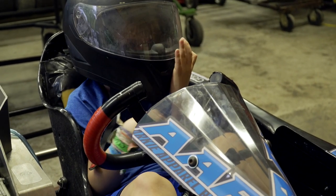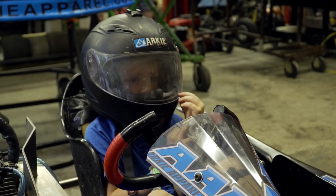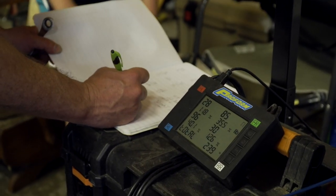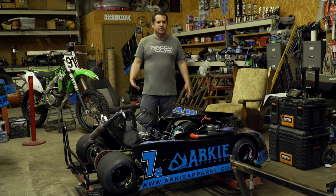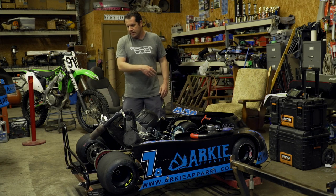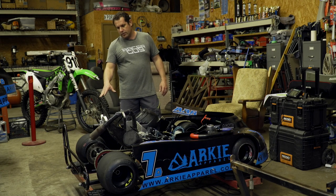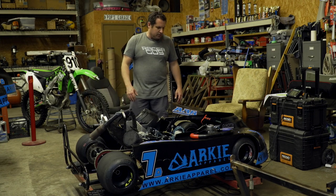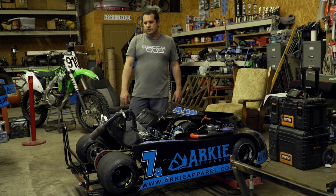Finally ran all the numbers on it and we're right where we want to be. We got the cross back up — 64% is what we wanted to do, just get a good baseline, that's a good starting point. Now we've got adjustability in the kart since we've got the washers split and we've got the rear right where we want it as well, as far as the weight jack on this cassette on the rear axle. So we've got a good starting point — that's what we want.